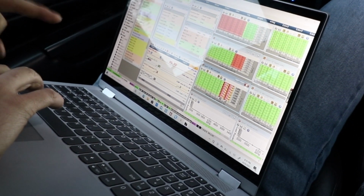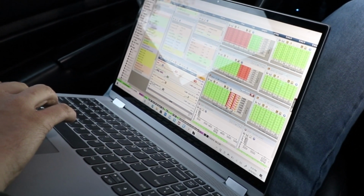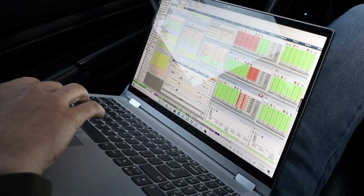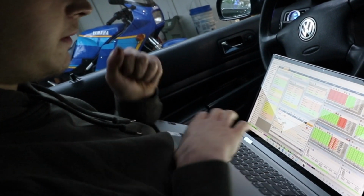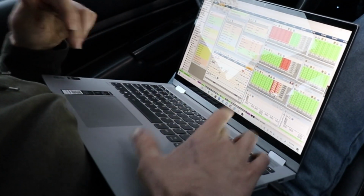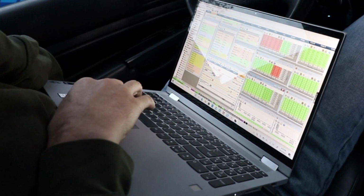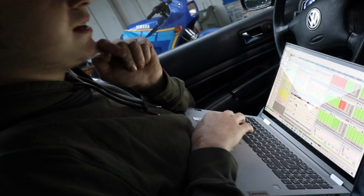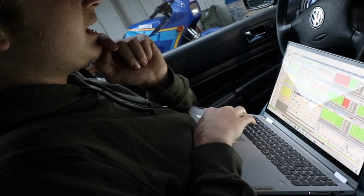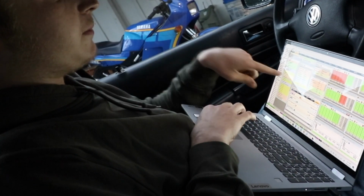But you're only going to 4,300 RPM. So it's not gonna make that much boost anyway. No, because it's not that high. Wait, is 4,300 high enough for you to launch, or you still gotta mess with it? I still gotta mess with it. I haven't really raced with it. True. And I know I had that at like 20%. So the wastegate. How much boost were you making? Maybe like 5 or 6 PSI. Is that good enough for you to launch? About what I need to be making. But when I took off, it bogged super hard, so I need to probably raise this a little bit.